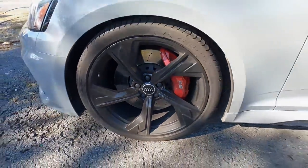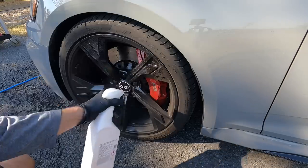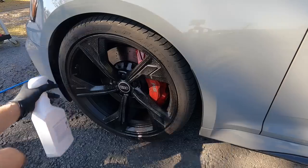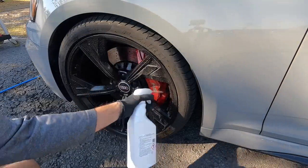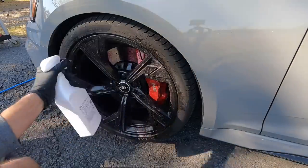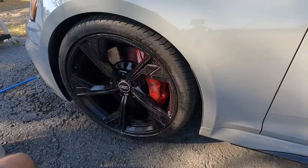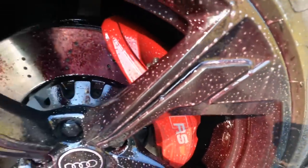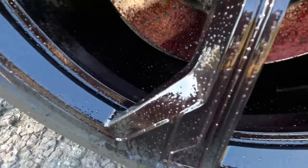Let me show you Auto Wheel Non-Acid Wheel Cleaner first on its own and using no contact whatsoever. So that spray, let it do its work, and then rinse without agitation. And then on the back wheel, I'll show you the Korrosol first, teamed up with the Auto Wheel Cleaner, layering that on second after a thorough rinse and then agitating, and we'll see just how much the first step removes without even touching the wheel and causing marring, because brake dust and rail dust is one of the most abrasive materials to come in contact with either your wheel or the side of your vehicle.